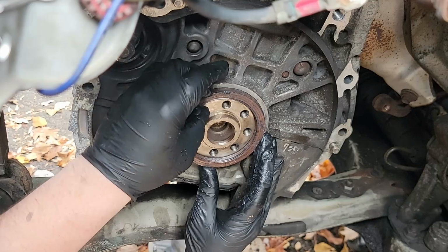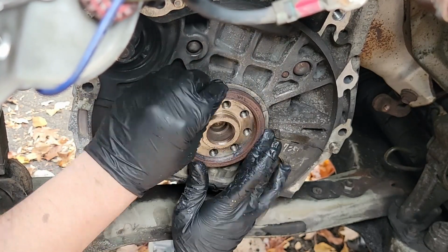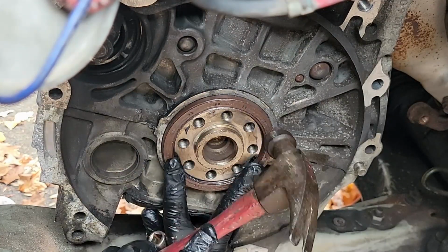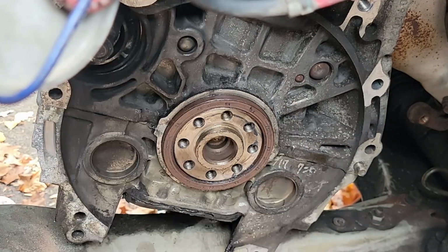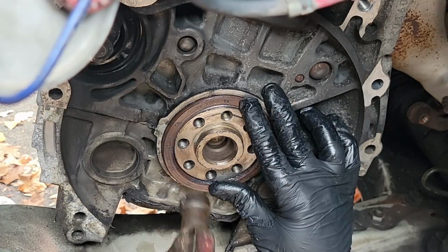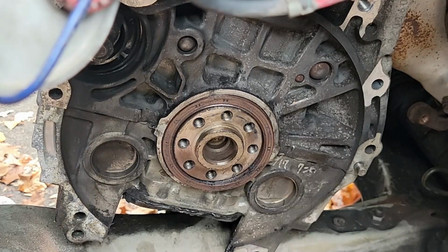Again, because I mentioned the seal is so large and it is so stiff, it is actually going to try to uninstall itself on me a few times here. You really need almost a second person to give yourself a hand, or just switch to using a small hammer. That's what I did to really help it bite into there. It's going to naturally try to pop out when you work your way around from one side to another.